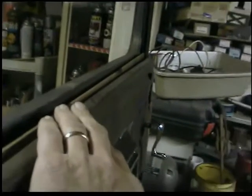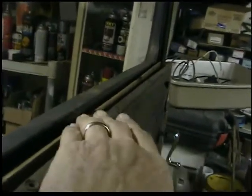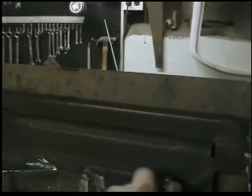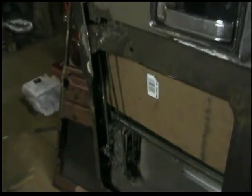Next, on the top here there's a piece that goes on here — actually there's a couple pieces — there's a piece that goes in with rubber that rubs against the window. You can see I still have the masonite in here. Let's crank on that and the masonite goes up, and the door handle's working, so the window's going up and down. You can see it's just on the inside of these rods, and it's on this side of the rod on the other side. The window goes up and down — it's not glued in, that's why this is loose, it's just sitting on it.